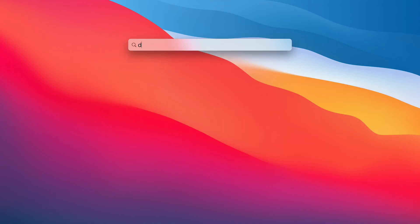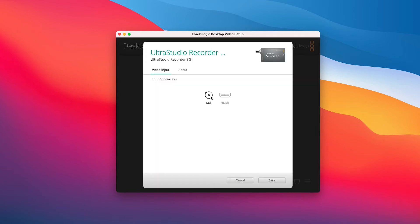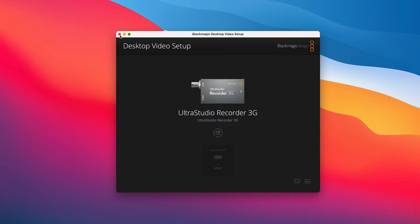I'm going to plug that into my computer. Now I'm going to plug in my video source into the UltraStudio. It's an UltraStudio Recorder 3G — 3G means up to 1080p60 — so we're going to plug in a source that doesn't exceed that. In my case, I'm going to use the HDMI output attached to the Blackmagic Pocket 6K camera I'm using to record this video. The next thing I'm going to do is open up the Blackmagic Desktop Video app. I'll minimize this and type in Desktop Video Setup. Here I need to make sure that this is on the HDMI port — it's always best practice to check this first. Click Save and I can close that now.